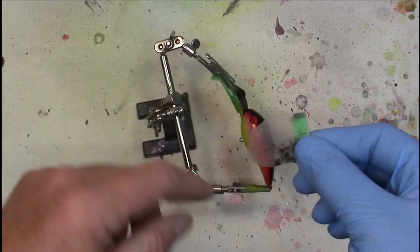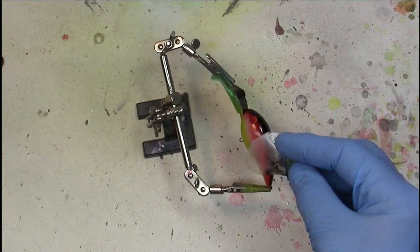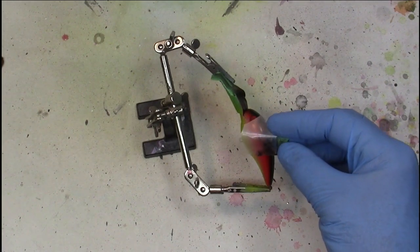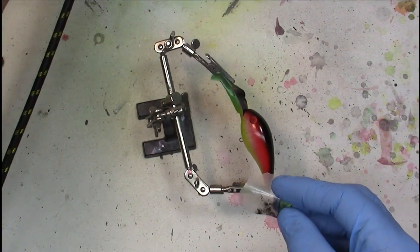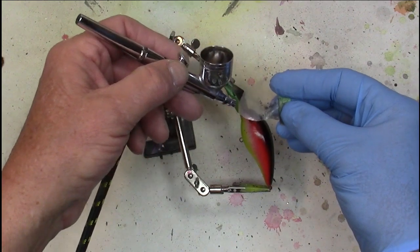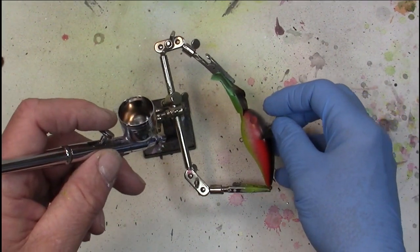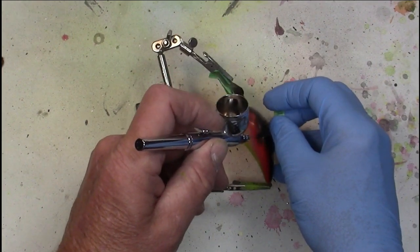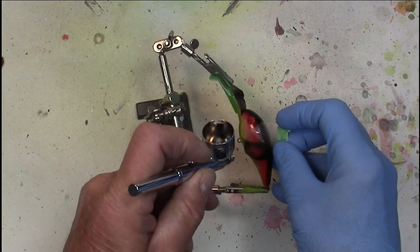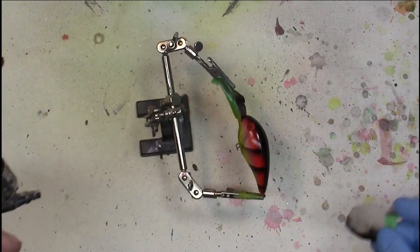This stencil is marked left or right, so I've got the same shape for one side or the other. I've taken the air gun down from the normal 40 pounds of pressure to 10 pounds of pressure — that's really all we're going to need for this. What we're going to try to do is spray on the stencil and let the drift over be our mark. I'm not the greatest with this, I've only done this a few times. So we'll just hold that in like this — leave a mark there — come back here — leave a mark there. How about one more at the tail end back here? Leave a mark right there.